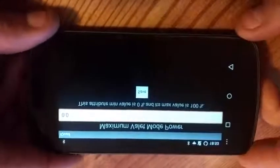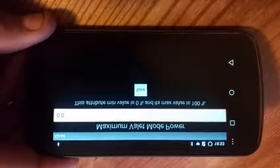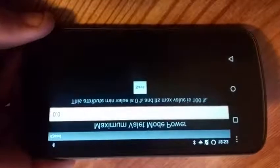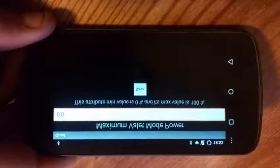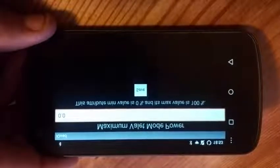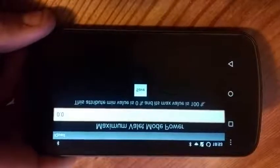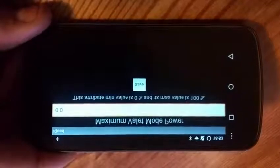Valet mode power, this is your level 1 setting. It'll actually set 0 to 100% of OEM power. So if you wanted a stock fueling truck, you would put it at 100%. That is going to give you 100% of OEM fuel. If you wanted to do like an emissions tune, you could set that at about 75% for a stockish truck, and that would make it so it would pass no matter what. Big injector truck, say some 7x13, 7x12, should be able to pass emissions pretty easily, setting this at about 50%.